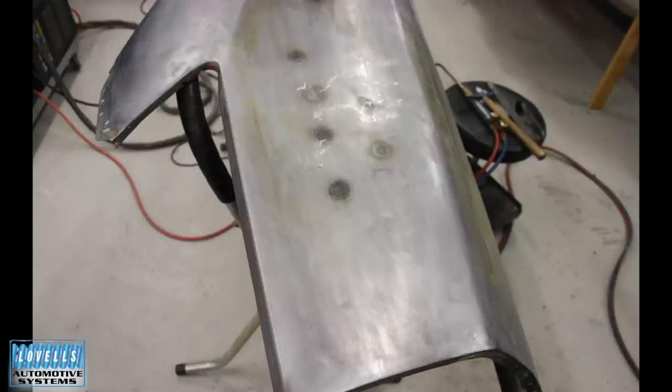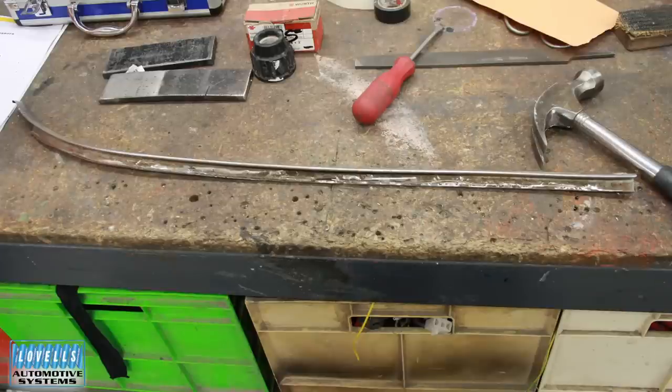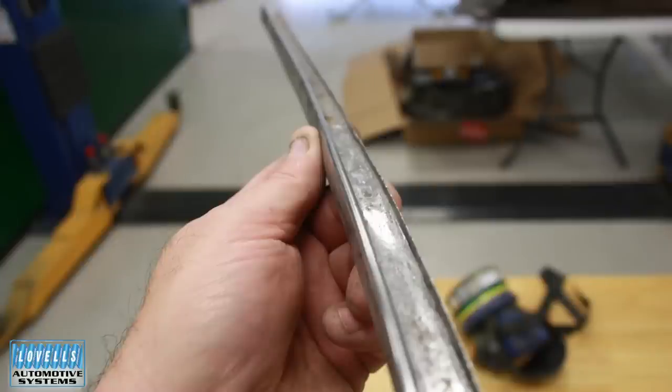The quarter there — I've got the oxy going doing a few heat shrinks. They really are a very big panel and it's rare you get one that doesn't need some work. The back window trim was bent up. While we're on that — Darren had done quite a lot of polishing before he came here, and a lot of people don't realize that just polishing the trim can change the shape. If your hands are too far apart you end up creating a big bow in it — from both the pressure and the heat. Simply by being too far apart it's not properly supported while you're actually polishing it.